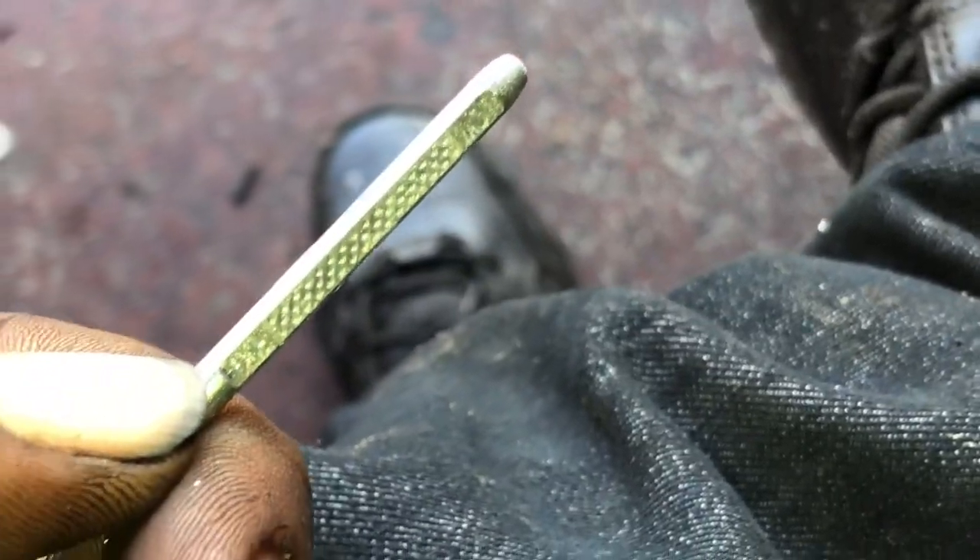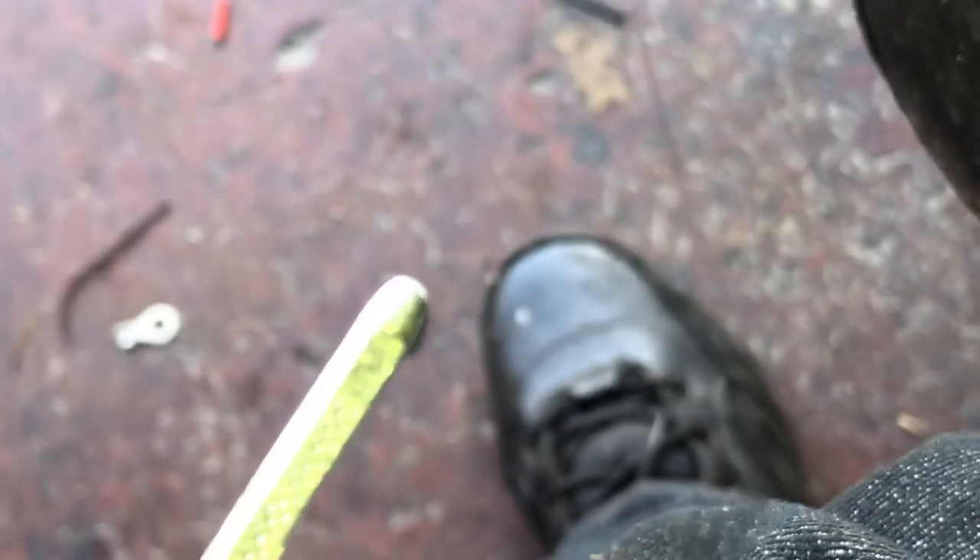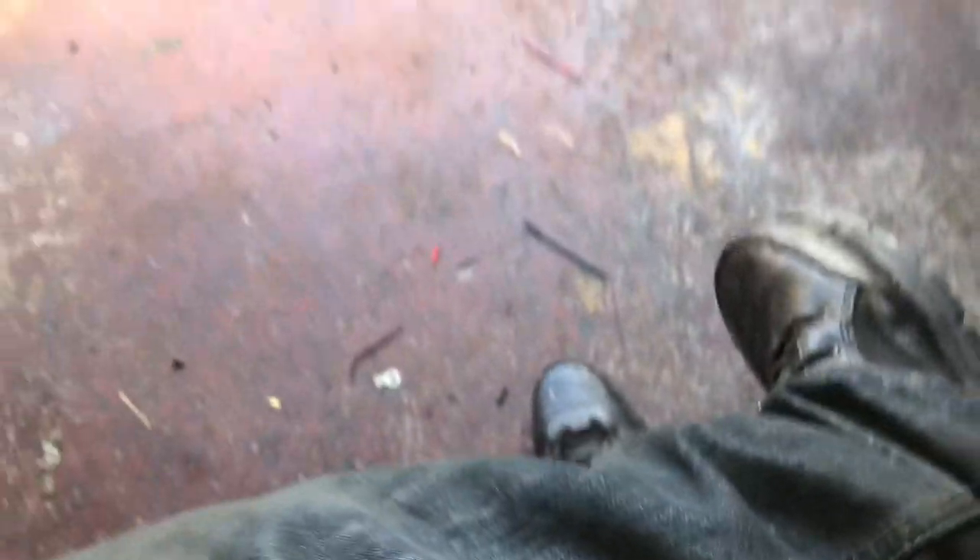This is what I hate about these dipsticks - looks beautiful though. One side says 'full,' this is the full side; this side says 'low.' It's hard to read these on a 4L80E. They take 12 to 14 quarts - I know I'm about to get heat for this - and if you have the Moser-style deep pan, it's up to 14 to 16 quarts. That's a lot of transmission fluid. Don't go putting that in your transmission and messing it up and blaming me - look up your car's specs.